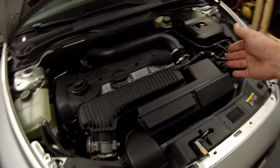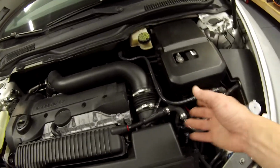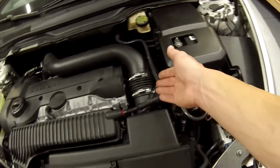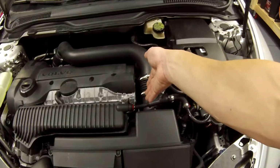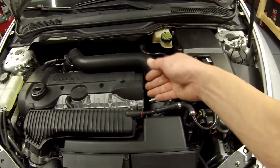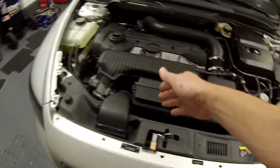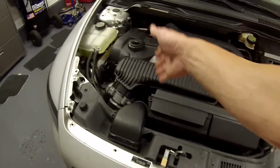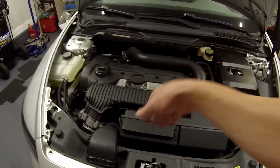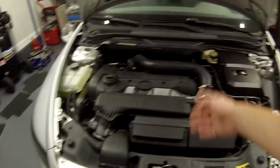Oil leak. It is leaking from what I would call a rear main seal, but I guess it's a side main seal, I don't know, because it's a laterally mounted engine. But the seal on the crankshaft between the engine and transmission is leaking and no good. I assume this probably had some kind of a PCV issue, because it has the updated version of the PCV system in there already, and it looks newer than the rest of the engine did.